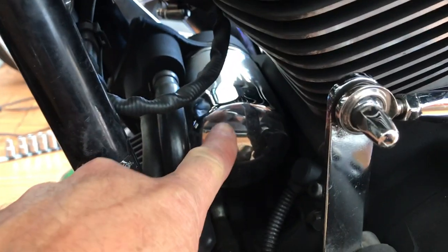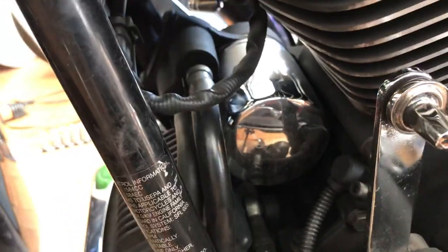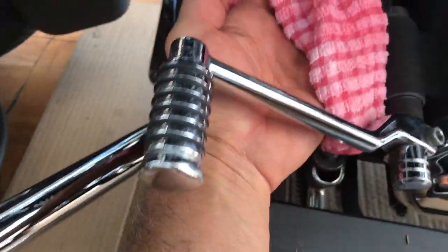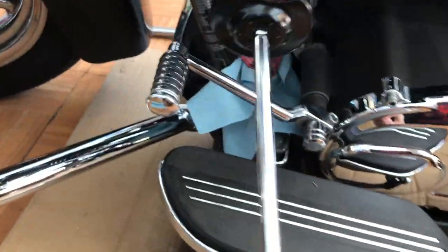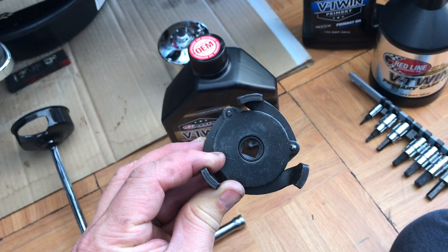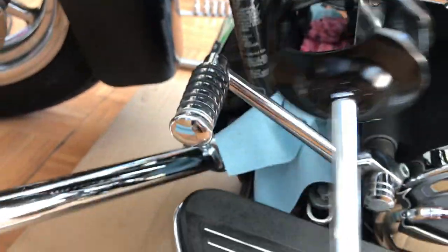When it comes time to remove your oil filter, you can use a wrench. This one needs a clamping-style wrench because it doesn't have a bolt, but the replacement filter I have has a bolt so it's a lot easier — you can use a ratchet. What you want to do is get some dish towels or rags and jam them underneath in that area so that when you take the filter out, you don't get oil everywhere. I'm using one of these oil filter wrenches — there are different kinds. You can also use a clamping kind which is more universal, although they tend to crush the filter, so use that for removing only, not for putting a new one on. This cutout section can be handy for working around items to get it to fit.